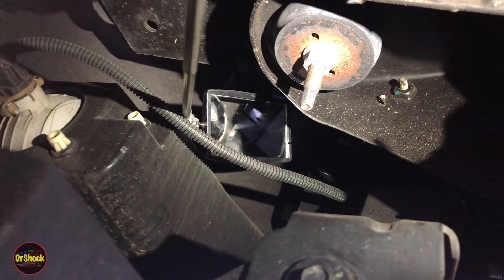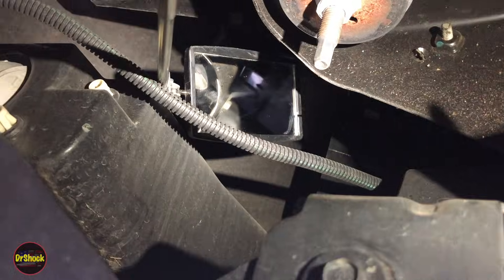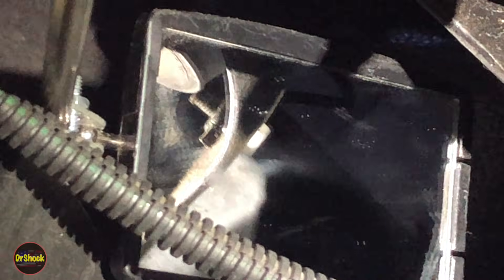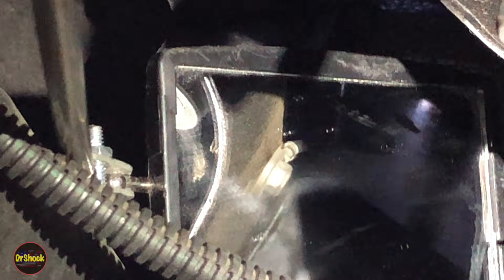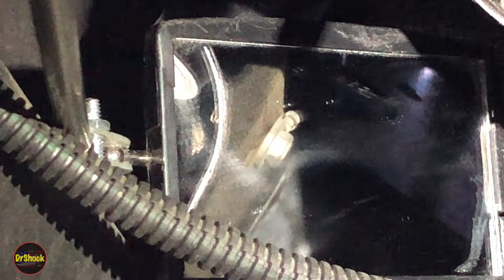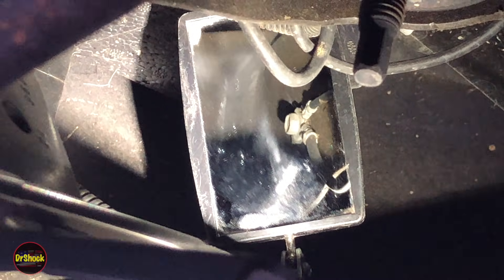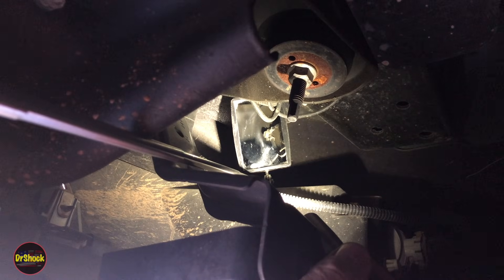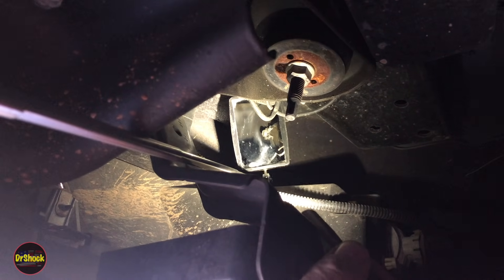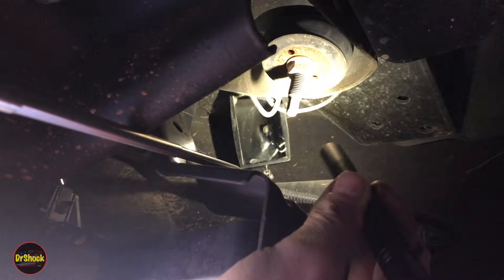On the driver's side under the bumper, past the frame mount, we can see G100 — that little silver bolt visible in the mirror. On the passenger side, that's G101 in the mirror with two leads going to it. Zooming out for orientation, you can see the passenger side frame mount, with G101 right behind that frame piece, visible from the opposite side using the mirror.